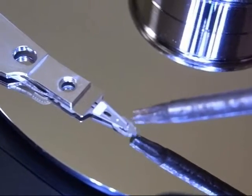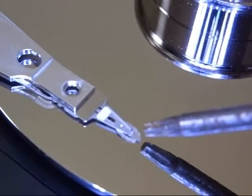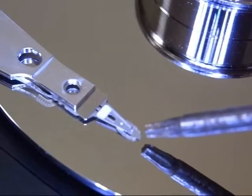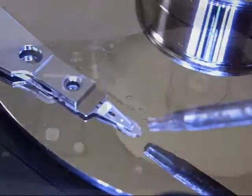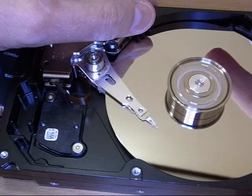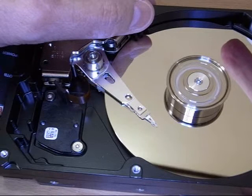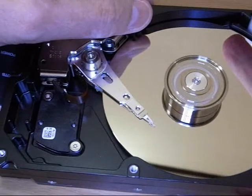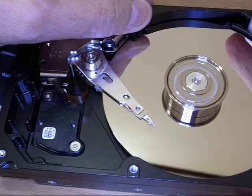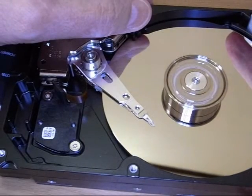Sometimes, because this is a magnetic device and the disc is magnetic, on a poorly designed disc it will start bouncing up and down in a washboard effect and slam into the disc, causing a hard crash — you can see microscopic pitting with the right microscope. Watch what happens when I drop this disc — see that head move? That's not a good thing. That banging can cause the head to strike the media. This is why you're never supposed to move a hard disc when it's operating, especially in a laptop. You want this disc to be parked against that hub if there's any impact.